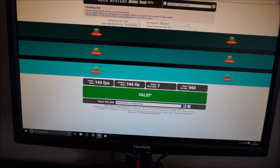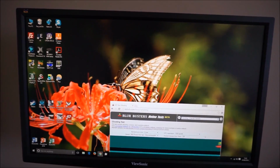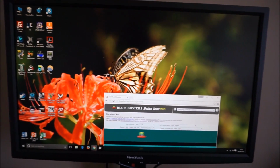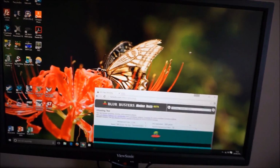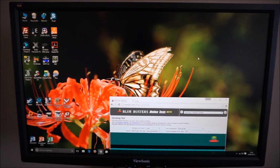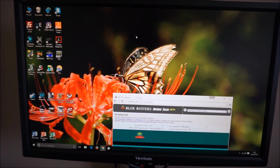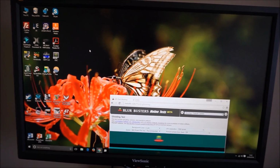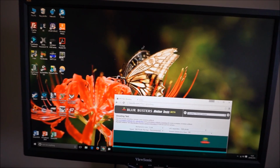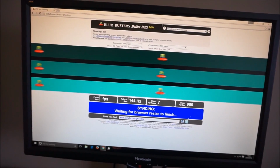But when you're just on the desktop, the first thing you notice is the felt responsiveness; the latency is very low indeed when you've got it set to 144Hz. It has 3 different input lag settings. I've gone through this in the written review and also in the OSD video, but I use the ultra fast setting for input lag, not to be confused with the ultra fast response time setting, which is a separate setting. It doesn't have any negative consequence on image quality, but it does mean the input lag, or the signal delay, which is the bit of input lag you can feel, is really low, and it's really nice to have that for a gaming monitor.